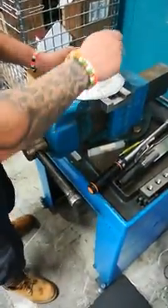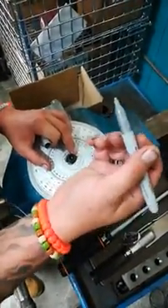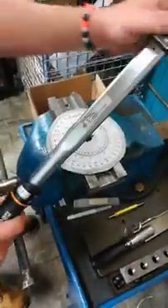What I do from there is — this is a 360 degree chart right here — I make the mark on my bolt with the silver sharpie, I just put a little small dot right where zero is on my chart. Then I grab my newton meters torque wrench. This is the process we do: three different criterias we have to meet. The first one is we have to meet the angle, which is the first four cycles — 60, 70, 80, and 90 newton meters — that has to meet a certain angle that adds itself up, which is at least 1.1.